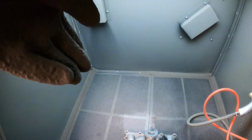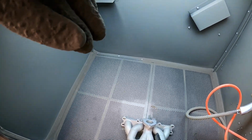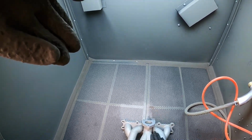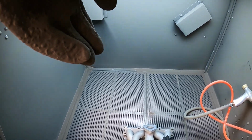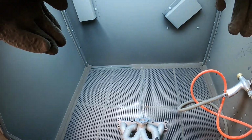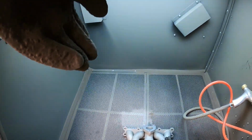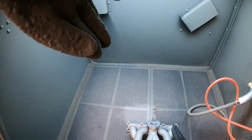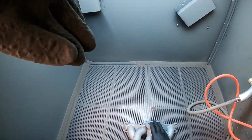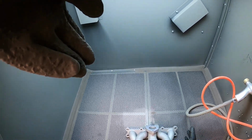After that, it ideally wants to go in the oven to outgas. The reason you need to outgas is when you heat it up to a certain temperature, all the gases inside the metal will escape. This stops bubbles. I know that the C series is an air cure, but it is still recommended that you bake it. You can use a house oven, which I'm going to use now. We have ordered a big oven, but it'll be here next week, so this is going in the house oven. According to Cerakote you can skip this step, but it's really up to you. I would recommend doing it.